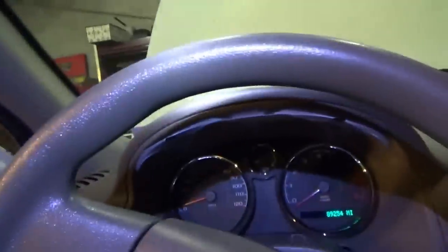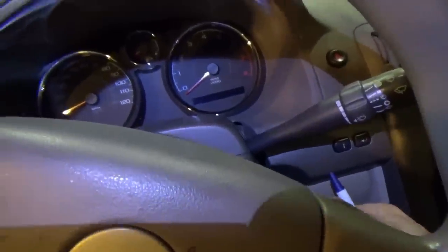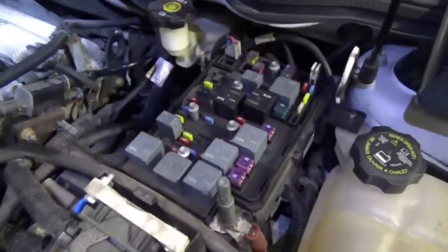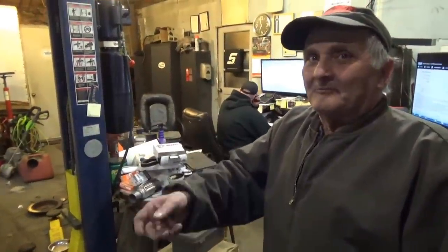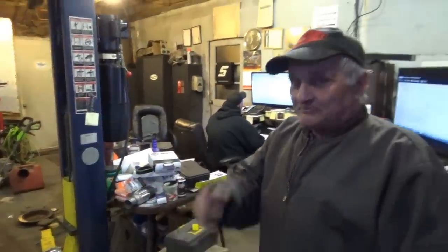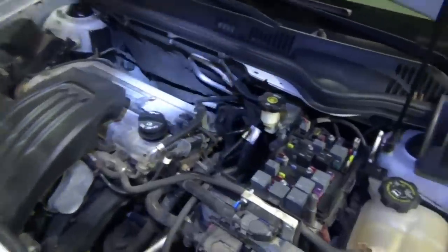Engine computer's right here. Let's try again — 89,000 miles. We got clicky relays, nothing when you turn the key to crank. Key off — clicking stops. So that's a good start. There's a ghost in here — that's the problem. A couple times when I turned the switch off with the relay in, it actually tried to turn the starter over with the key off. Like the starter solenoid going 'doosh doosh doosh' — a few times it actually spun the engine over.